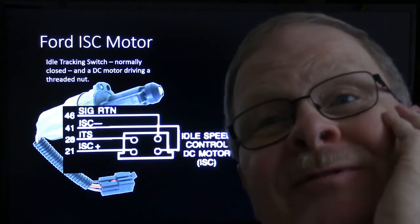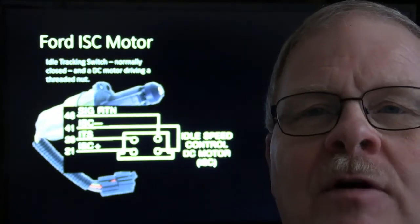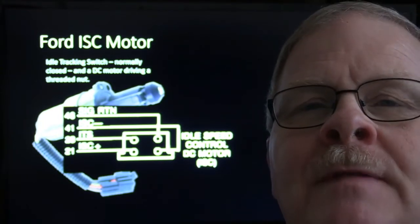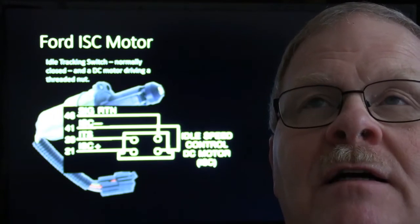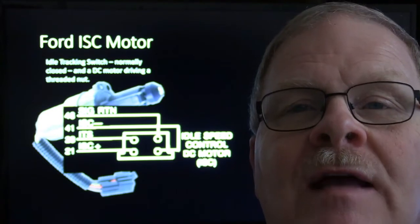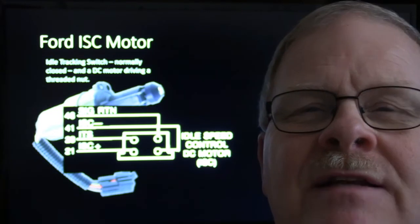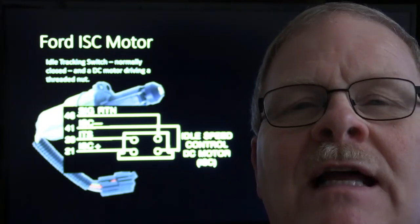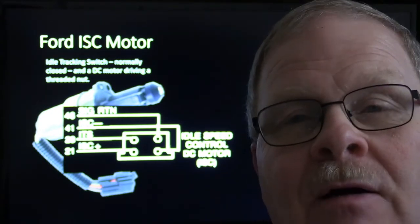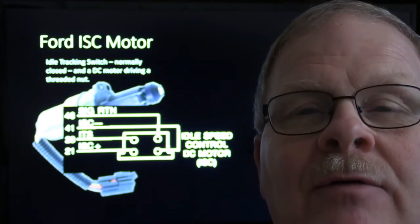Of course, I'm one of those kind of people who likes to fix something if I can. But basically, if you want to prevent yourself from having a comeback, the smartest thing is just to pop one on there, you know. And I also built a little tool using a rocker switch out of a Jeep Cherokee that I could connect to this. I had the rack connectors, adapters and all. And for these things, they have different connectors than that one on some of them. They had round connectors. Anyway, I could connect that thing and I would use that little power window switch and hook it up to power, plug it into this, had a little LED indicator light on it that I put in there, and I could run it back and forth.